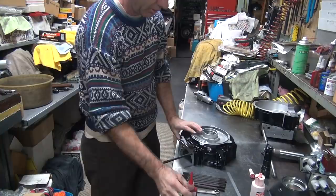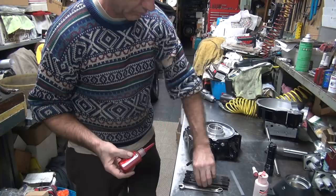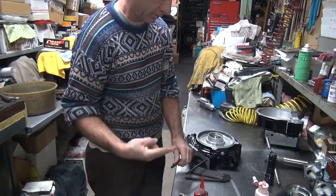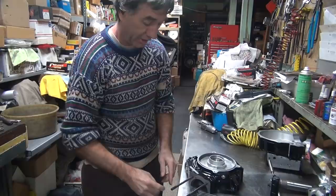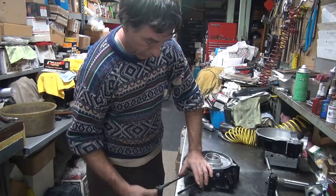Now we're going to do this again - try not to put so much Loctite on there this time. Harley puts these shoulders on all the places. When they first came out with studs they didn't have shoulders and had a big socket because they had a real bolt - they did that for two years. Then they got smart and went to a nut - called a sleeve nut. They went to a stud with no shoulders, then a stud with a shoulder on top which didn't make any sense, then a shoulder on the bottom like these, and now I guess they're back to no shoulders again. But those other ones were tight when they went into the case - they weren't loose. So Harley has gone backwards on their engineering, at least that's what I think.